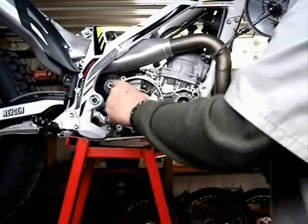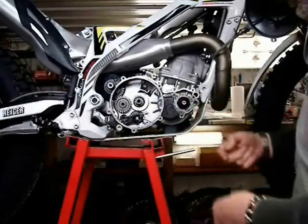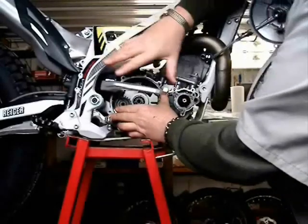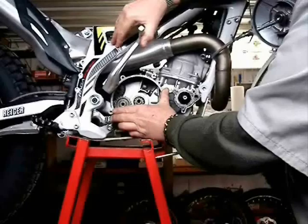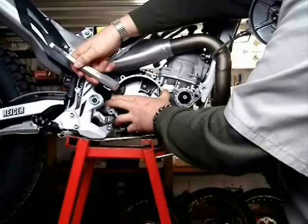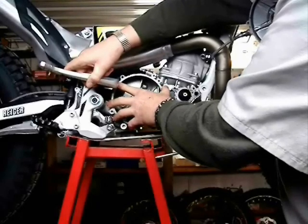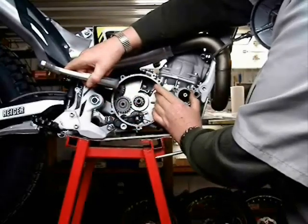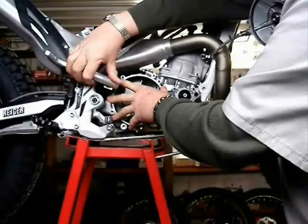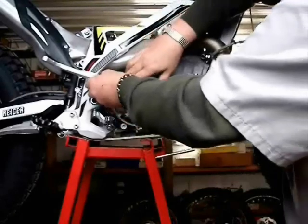The next thing we do is rotate that shaft counterclockwise to wind the return spring. We put the pedal on way forward and then wind that pedal around. With the clutch off, you don't have the gears running through, so you don't have a problem with compression working against you. As you're winding the pedal around, you wiggle and push gently on the cover, and then you can see that the thumb has fallen into place.